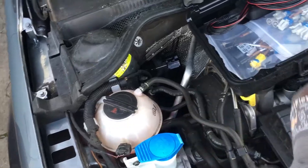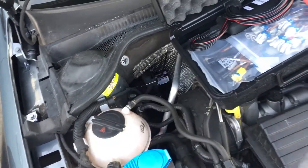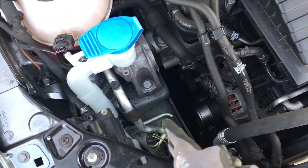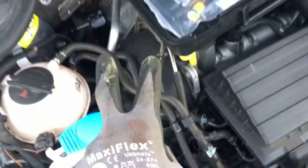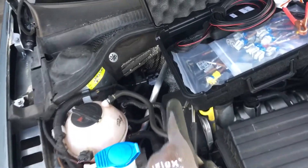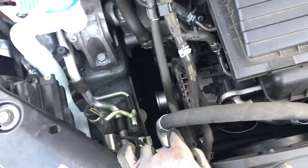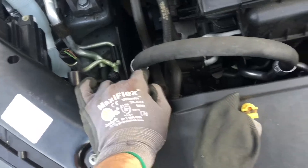The system engages the clutch, the clutch is spinning, but you look at your gauges and they are still equal — whether it's 60 and 60, 70 and 70, 90 and 90, no change at all. You can turn the AC off and on and see the clutch engage and spin, but there is no movement on the gauges from the compressor engaging and disengaging.